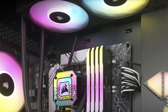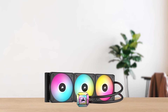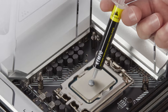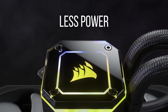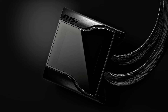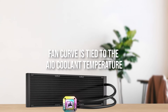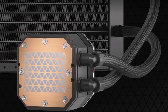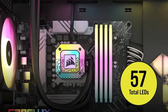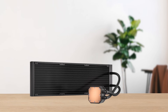This model builds upon the success of previous H170i AIOs — the direct predecessor being the H170i Elite XT. This newer version takes advantage of brighter and more efficient Capelix LEDs, and also uses newer high-performance thermal paste in the form of the XTM70. There's also an LCD version of this cooler featuring an IPS LCD block, similar to what's seen on NZXT's Kraken line and the MSI MEG Core Liquid S360. One interesting thing about this cooler is that the fan curve is tied to the AIO coolant temperature, not the CPU temperature, meaning the transition to lower or higher noise levels is smoother.